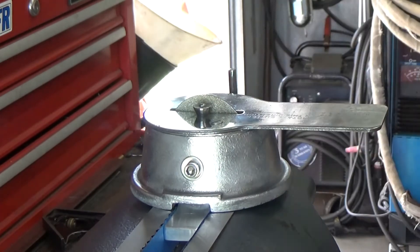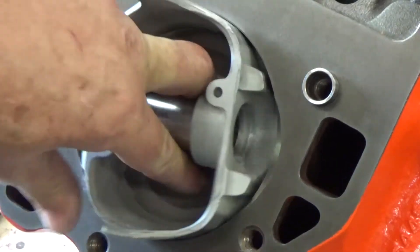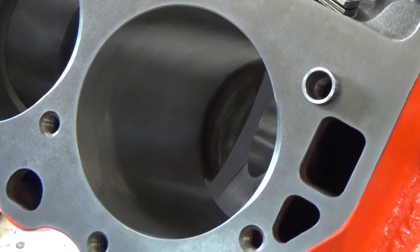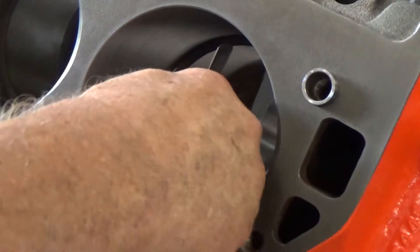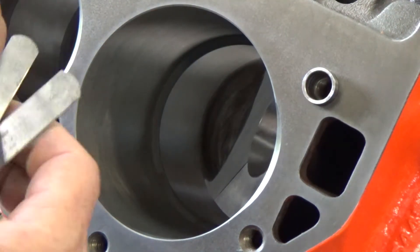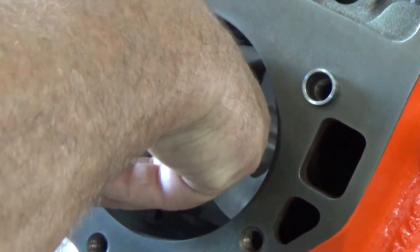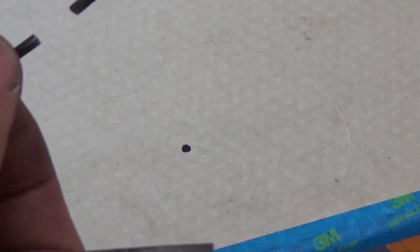You might think the second ring gap wouldn't be larger, but the whole idea is: the more power and heat you put into the engine, the more things expand, so gapping prevents the ring ends from butting together under a high-horsepower application. You'd think the top ring would need a larger gap, but my understanding is the second ring is kept slightly larger to prevent ring flutter — if pressure builds between the two rings, it can actually lift the top ring and break the seal. Here's the scotch wheel I use for deburring, and I still take a file to hit the inside edge a little bit.